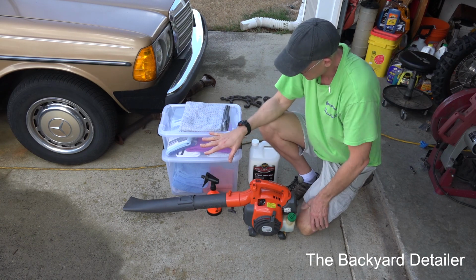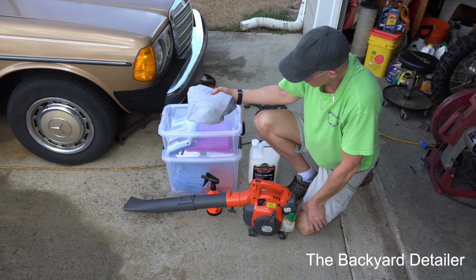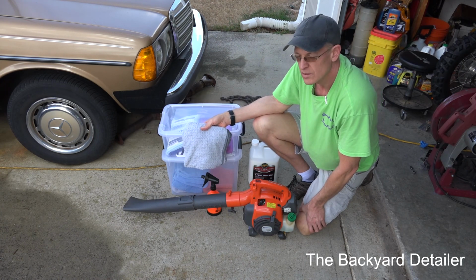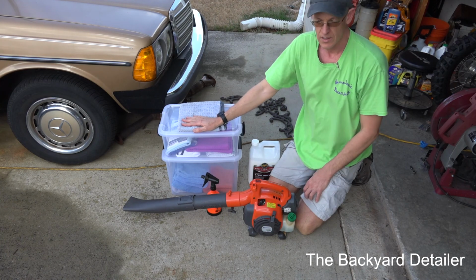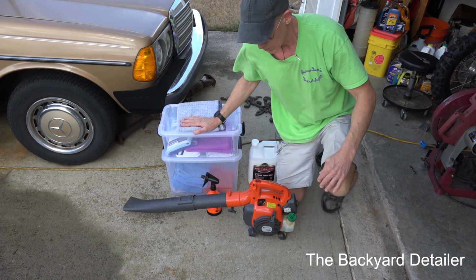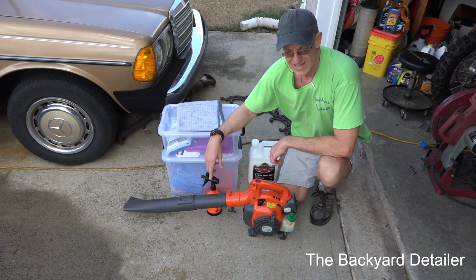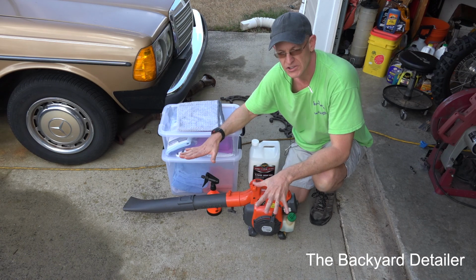So all this is to minimize scratches, and I think probably out of all this, the most important is your microfiber towel. Please do not use a terry cloth towel. Don't use a California water blade. Don't use a chamois. All that stuff was what we used to use in the 1980s and 90s. The best way to dry the car is to not touch it.